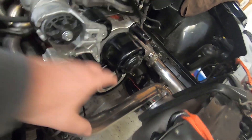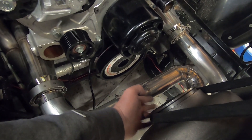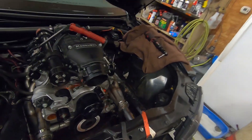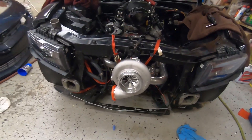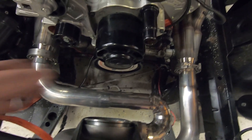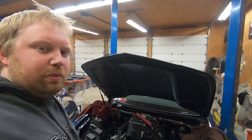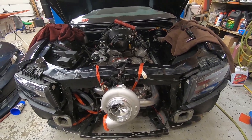The exhaust is going to be pretty close. I'm planning on coming out with two 4-inch pipes split right here, and the bottom of the turbo is right at that — I'm hoping we can clear it. It's going to be stinking close; I realized that after I tack welded it all together. Centering the turbo was a pain — it's close but not perfect. The center of the turbo to the center of the water pump is just off a hair. But if I turned it then the front of the turbo wasn't perfectly in the middle of the bumper, so I had to decide. Slamming it in the middle like that is not very easy.